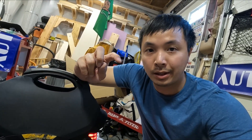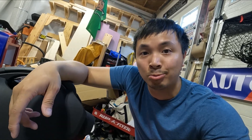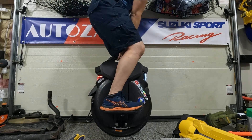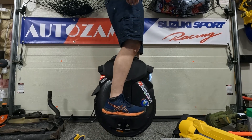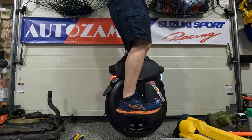Adjusting the tire pressure didn't seem so bad either. Because of the angled valve stem and it being a tube tire, it has some play, so it's easy to actually access and inflate your tire if you need to. Now, what did that actually do? I'm going to see if I feel any difference with some pressure in the negative chamber. Oh yeah, there's definitely a difference. With 40 PSI in the negative chamber versus zero, the rebound is definitely not as harsh. Can't wait to try this out.